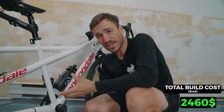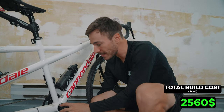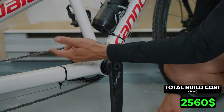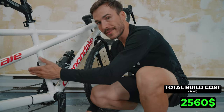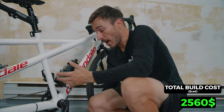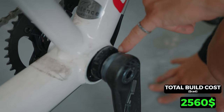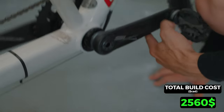Next we need to talk about something I'd never seen on a bike before — it's called an eccentric bottom bracket. Basically it goes inside a larger shell in the frame, and what it does is put chain tension on the timing chain side. When you put your chain on and want to add tension, the BB rotates inside the frame to tension it. It was difficult to figure out how to install and make it work, but now it's working. Another problem was installing the BSA bottom bracket — I feel there's still too much space on one side and I'm not entirely sure I did it right, but it pedals and it works.